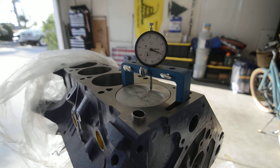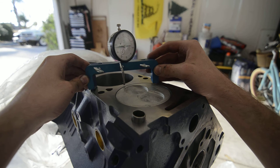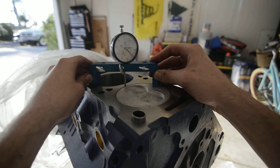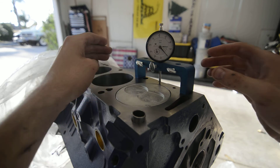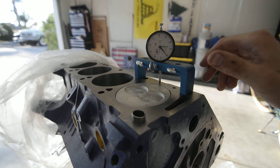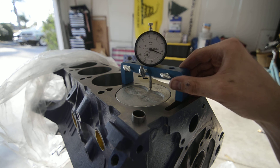Which is a little bit higher up than we expected, but we'll see what happens. Just for verification — if you bring the bridge over here, it's a bit oblique but it's still zeroed. Indicator still says zero, so the bridge is at least square around this piston. About seven in the hole.